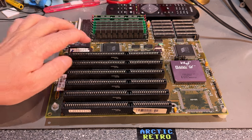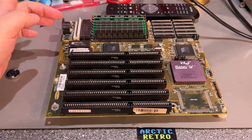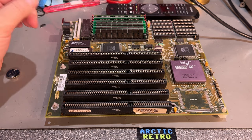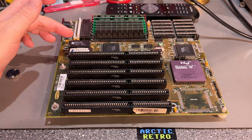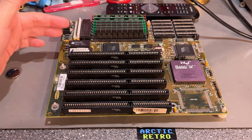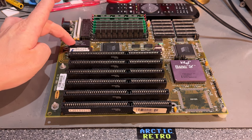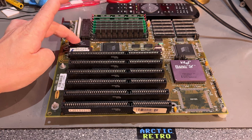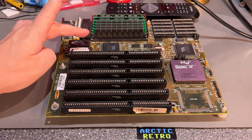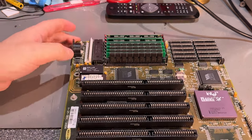This is an old motherboard with a 486 SX CPU. This board is working — I have tested it. However, it does not retain its BIOS settings for the clock and the configuration of the hard drive and floppy disk drive. If you set the settings in the BIOS and just reset the machine then it will keep the settings, but if you turn it off and on again it will lose them. It's kind of tedious to have to enter the BIOS settings each time. This chip is responsible for storing the BIOS settings and keeping the real-time clock running while the machine is off, and the little battery inside — guaranteed for 10 years — is now dead.